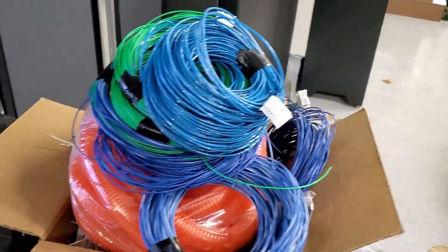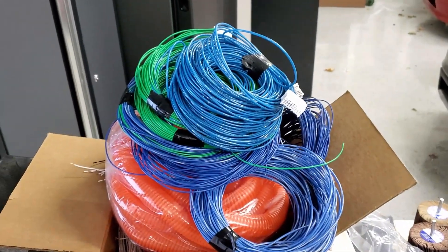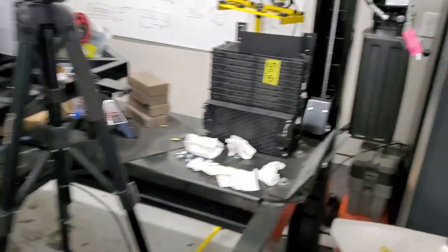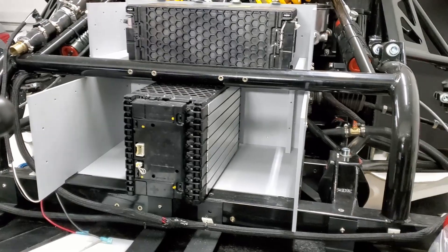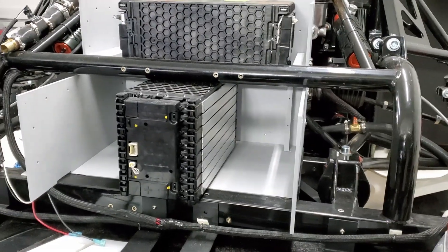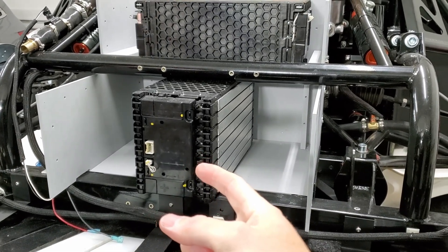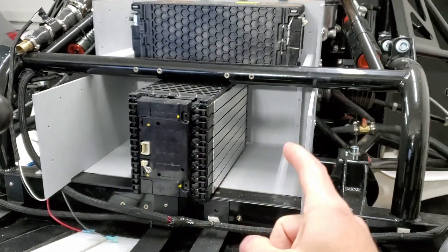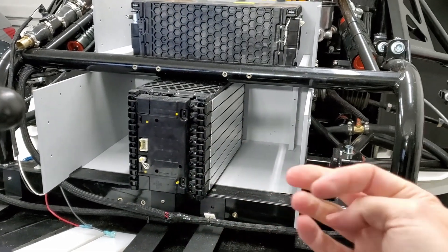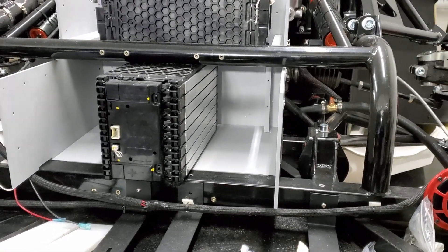I got eight bundles there and I believe I've got all the connections I need. I will now go put the battery modules into the front battery pack here. I'm going to hook up — I probably have this one backwards from how I want. I'll have the main terminals and one of the plugs coming out to the front and then just one to the back. I'll put all the back ones on, get everything in place, and then I can have access to the front.